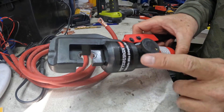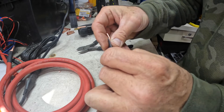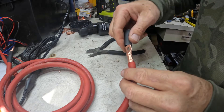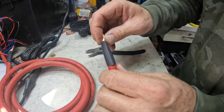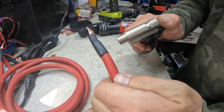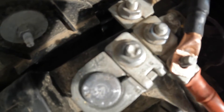If you're doing a lot of bigger wire projects, this tool is a good investment. Now we're just going to put half-inch heat shrink over this two-gauge cable — it seems to work well. We're just going to measure it from about there to about there. I don't want to make it real long because I don't want to cover much of the red up — I do want to recognize this as a red, hot cable. So we're going to pull it back a little bit to make sure it'll lay flat against the battery mount. It would be nice to use red heat shrink, but I don't have red. Let's see what kind of fit this is — we've got our lug on there. It's a pretty good fit.